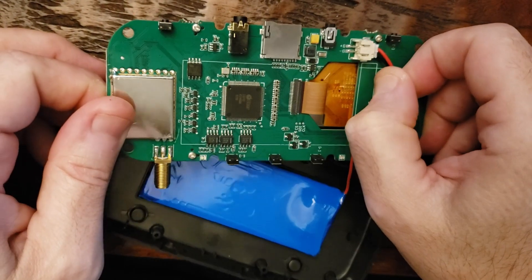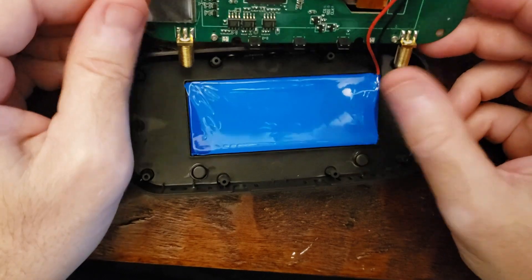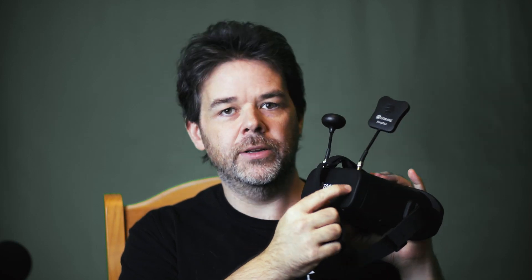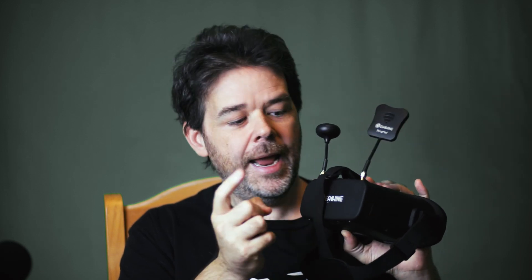There's the battery — you'll notice it's a very tiny normal connector up top, and that should make modding this very easy. Right here looks like a good spot to put a JST or XT30 connector so that you can add another 18650 laptop battery cell, a lithium ion, or a LiPo battery on the outside. Or if you want to use a case you can get a standard connector and put it in. I'm going to drill a hole through here and that's where I'll put my connector so I can add another battery.